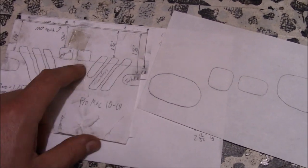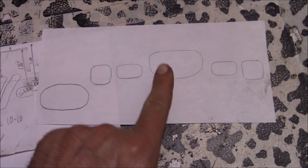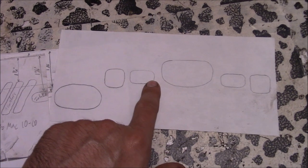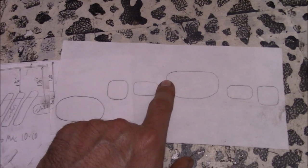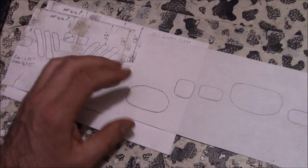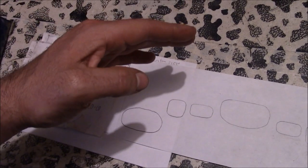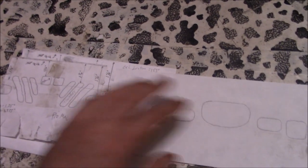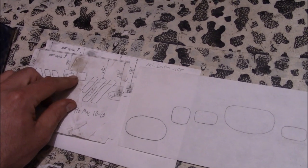Now, as a comparison to the chainsaw, here's a port map off a snowmobile engine. And as you can see, other than being obviously scaled up, there's actually a lot more exhaust port timing and duration on the sled engine versus a chainsaw. Generally, more exhaust duration leads to higher RPM and higher peak power at higher RPMs. Now, a chainsaw spins pretty fast, so why wouldn't you have a lot more exhaust timing on this?